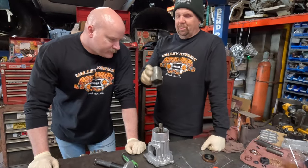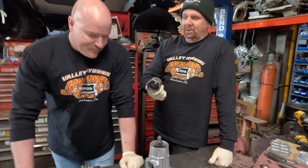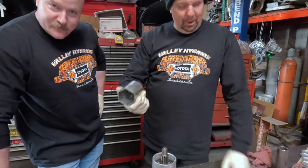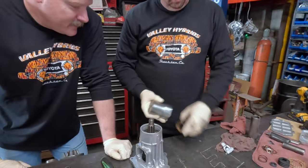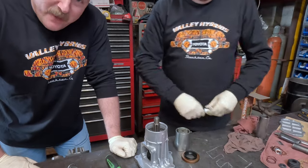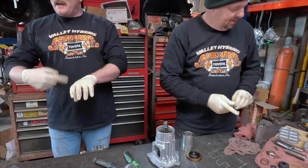Okay, who knows what this is? It's a rolling head pry bar. We used one of these in a previous video a couple of years ago when we built the knuckles and did the disc brakes. A 54-millimeter hub socket just so happens to be the perfect size to install a pinion seal — or transfer pinion output seal — instead of using a hollowed-out spray paint can, which I was thinking of doing. I did use a paint can on the axle seals; I'm not proud of that.